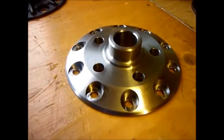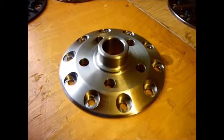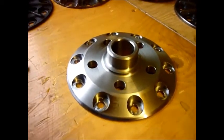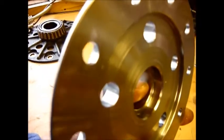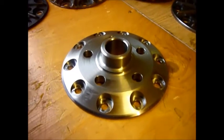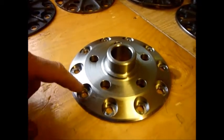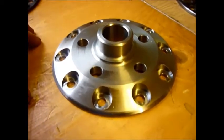So I have decided to build a replacement unit - this is the XS RD56 and RD03, CNC machined out of proper hard metal, heat treated, ready to fit end plate. These have been made cunningly so that you can actually fit them to either the 10 spline or the 24 spline unit. Everything is radiused so that it's a lot stronger. Where the crown wheel bolts through you're looking at twice as much metal, and it's proper high quality EN24 metal which is heat treated. These are not going to wear out. The bolts are a snug fit, the holes have been made smaller for a tighter fit, and just generally everything's been beefed up and made out of a higher quality metal.